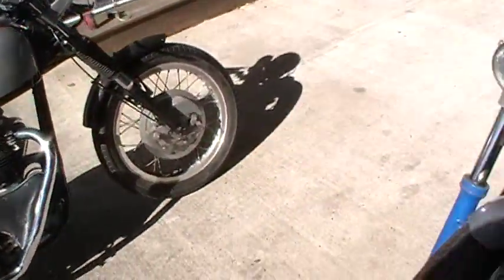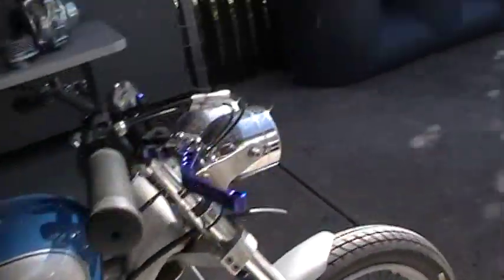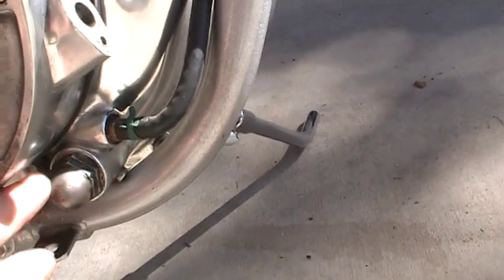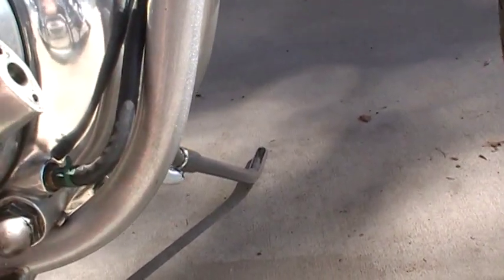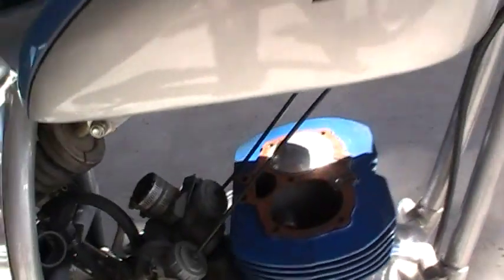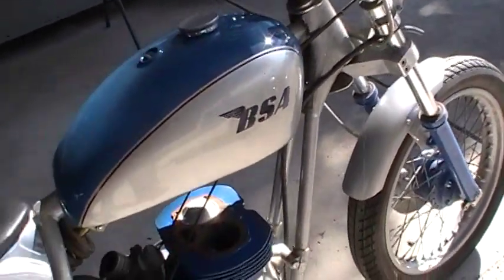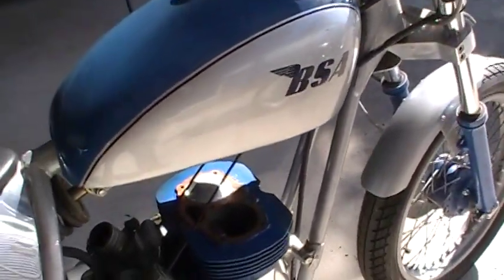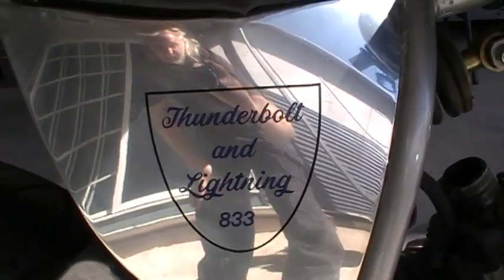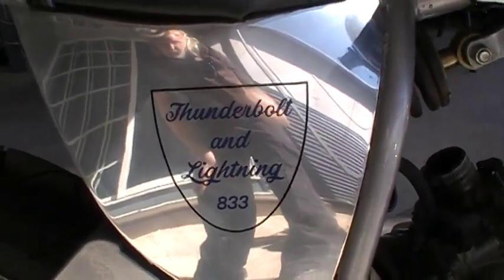It wasn't until very late in the piece that with an A65 like this thing, they had the casting and that. I'm not sure, I think they had the early pressure relief valve, and then a couple of years later they started using the Triumph dome, which is a much better piece. This is an A65, it's got a Devi Mead big block, and internally it's actually a little bit of a silly name, but it's a Thunderbolt on the cases, on the Lightning top end, 34mm Mikunis.